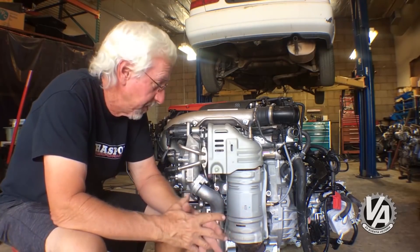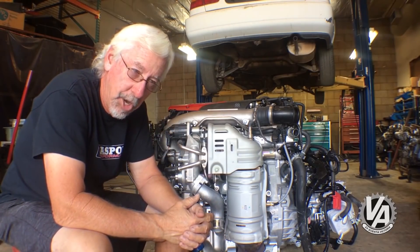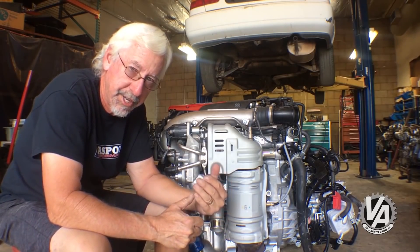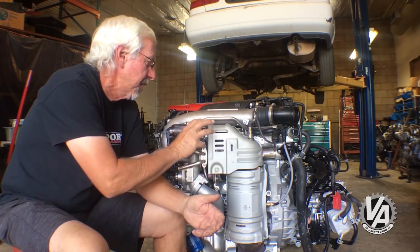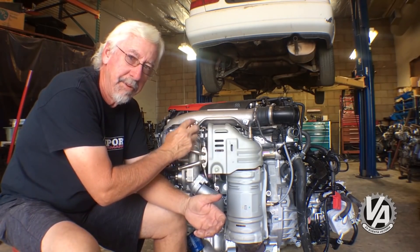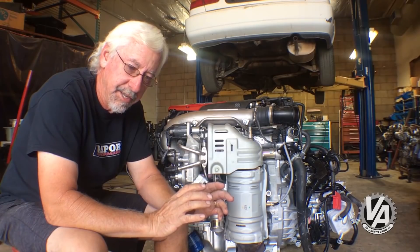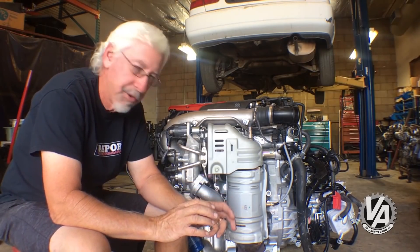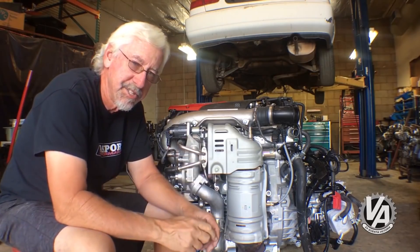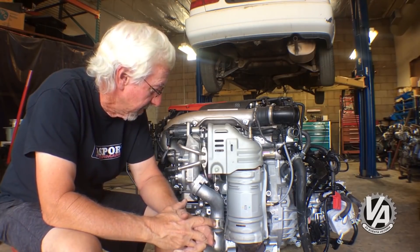The Accord actually has a different turbo as well. As mentioned, the O2 sensor is on the turbine housing part of the turbo, so it's monitoring gases before they get mixed up by the turbo. The turbine housing is made of a proprietary Inconel alloy. Inconel has excellent insulating properties, so most of the heat from the exhaust gases - instead of heating up the housing - is actually used as energy to help spin the turbine wheel faster.